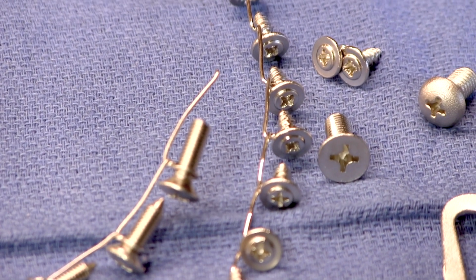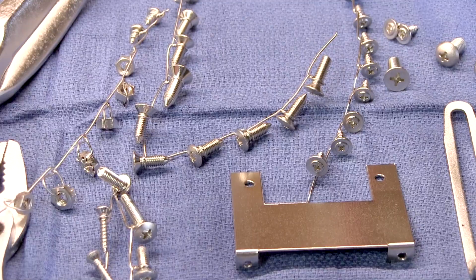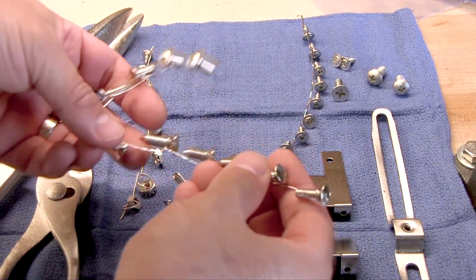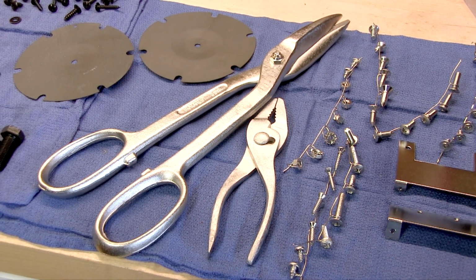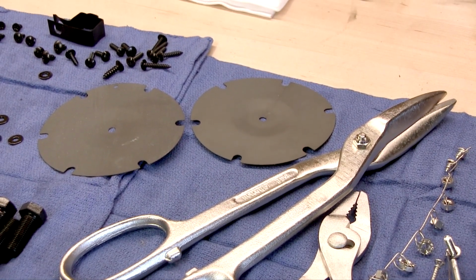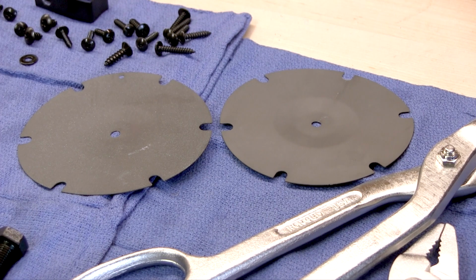Part 1 of brightwork will be me polishing up the chrome, the shiny stainless steel, and part 2 will be me installing it on the car. Most of these screws here are from the mirror and ceiling mounted dome light. Off to the side I got a couple of pliers that were in use in my garage. The big tin snip, you're going to see that prior to the plating in the headliner episode. The only thing holding up the rebuild of my horns was getting these 2 diaphragms plated. I thought about painting them, but it really looked like they were plated coming off the car. That's what they did. I think they called it a zinc phosphate at the platers.